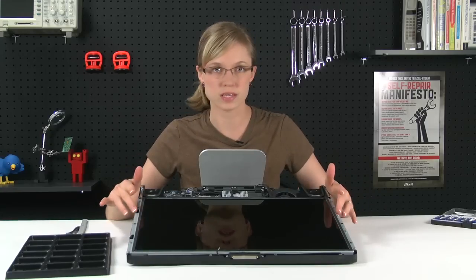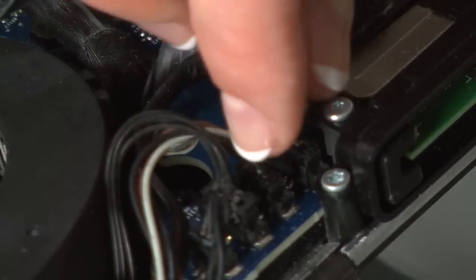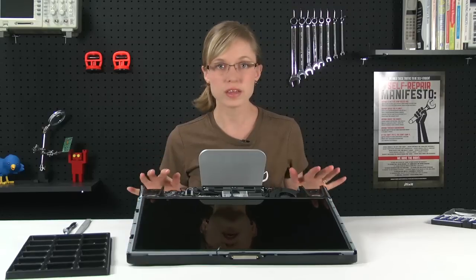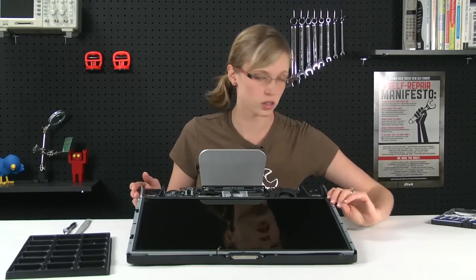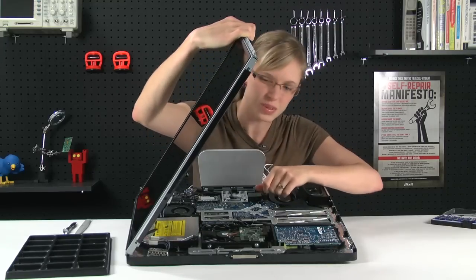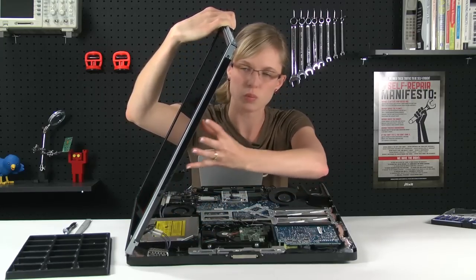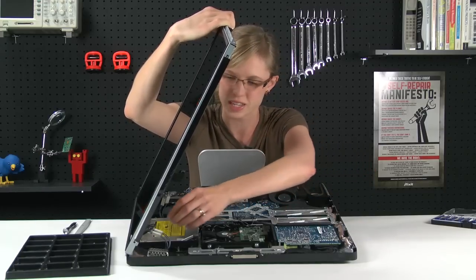The next big step is to remove the LCD, but before I can do that, I'm going to need to disconnect a couple of cables and remove a couple more screws. Once everything is disconnected and all those screws are removed, I'm going to lift the LCD off, starting on the left side and rotating it towards the right side. You'll see that it is still connected to the logic board via the inverter cables. This is kind of the tricky part — you can either prop it up on something and then disconnect them, or maybe ask a friend to hold it up for you while you disconnect the cables.